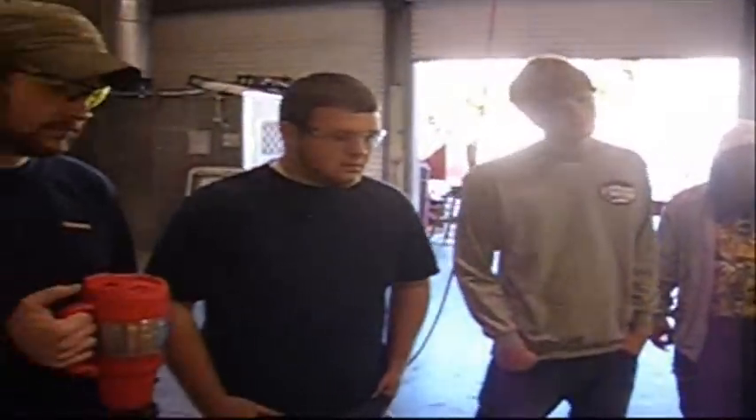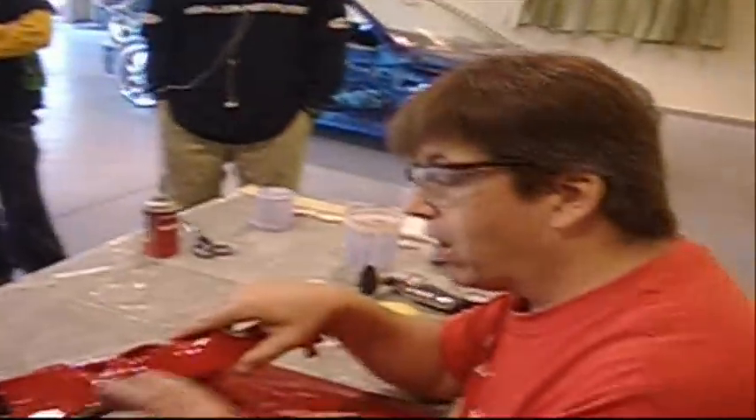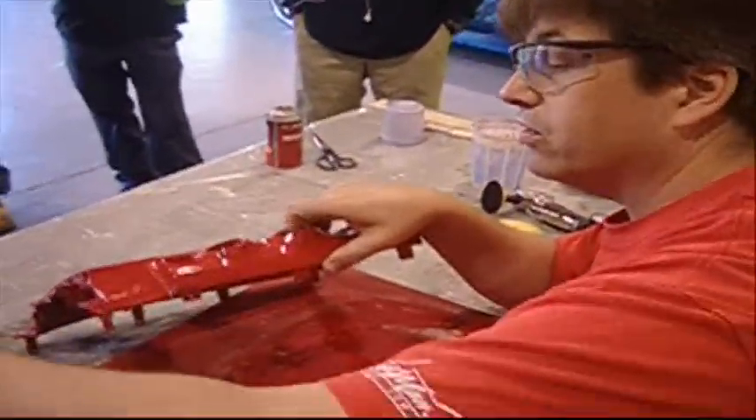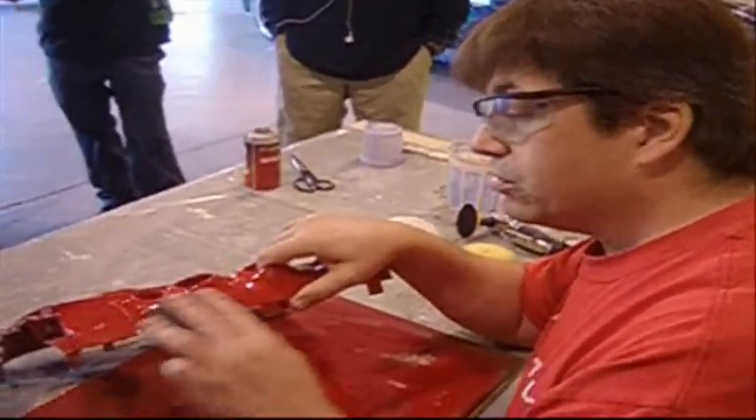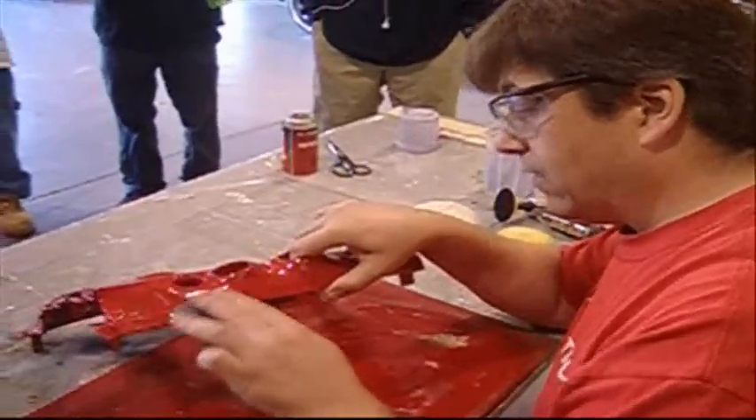You want to use your feel on this. As I set this down, I actually felt a little bit of grit. This is a super fine paper, 2000 grit — it's almost like notebook paper. If you're running this around and you feel it grinding, there's something between the paper and the surface. If you continue, you're just going to scratch it all up. So go ahead and rinse the paper and get rid of any of that grit.